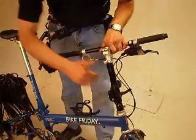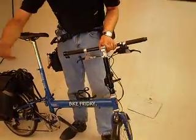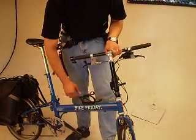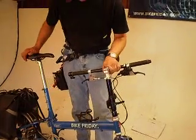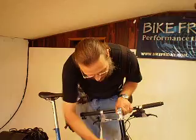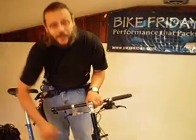When should the dots be added? The dots should be applied once everything is aligned, before you do the initial disassembly of the bike. You will receive the bike with the folding stem, get everything lined up good and solidly, and then before any further disassembly, take a little bit of white paint — or touch-up paint to match the frame color — or a couple pieces of tape, or nail polish, which works very well. Get those two little dots in there, let it dry, and that gives you a good indexing of how to assemble things so you don't fuss with it when putting it back together.